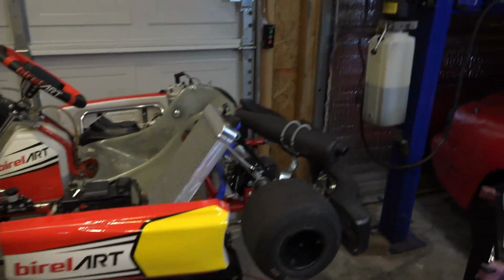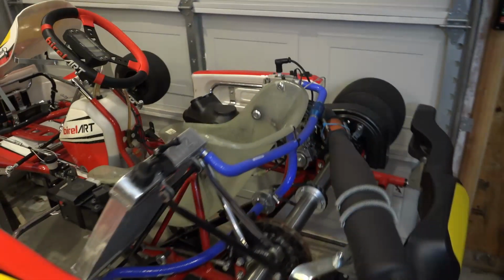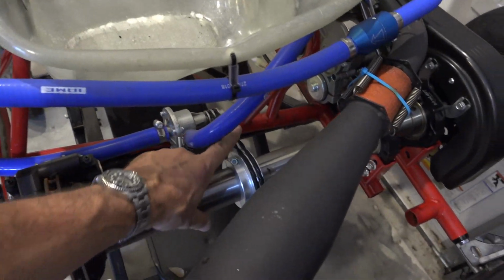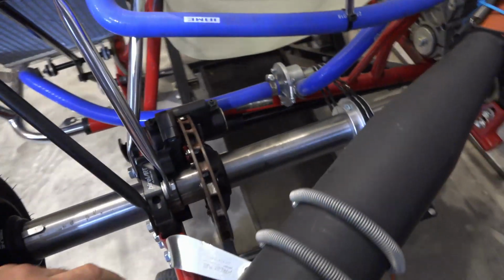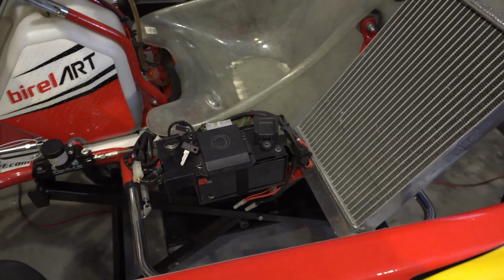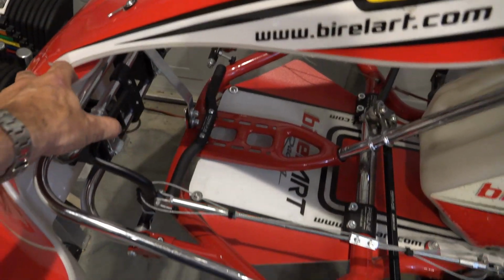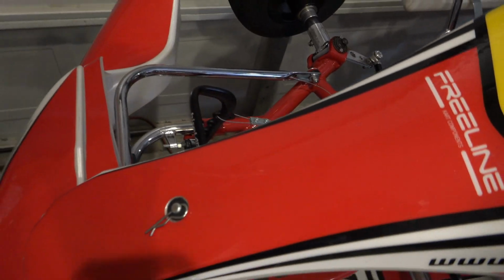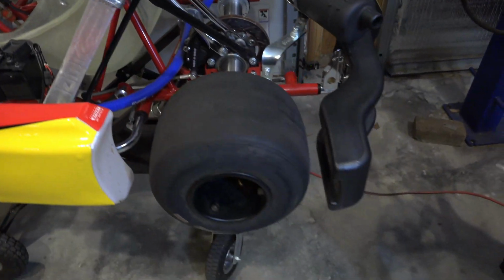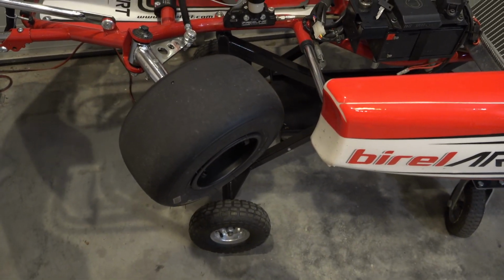Before we go on track, let's talk about this kart real quick. Just a couple of minutes. This is the X30 kart. It's powered by a 125cc liquid-cooled two-stroke motor, runs about 30 horsepower. Water pump, right there, run by these little rubber bands directly off the axle. Single brake in the rear. Big radiator up front for this Texas heat, and it's electric start. Brakes, right there. Accelerator, right foot. Gas, right between your legs. Slicks, 11 by 7.1 in the rear, 10 by 4.6 in the front.